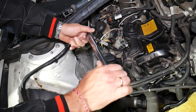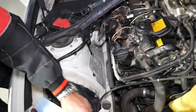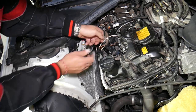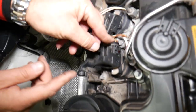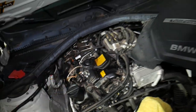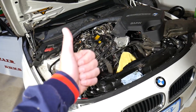That's it — one well-torqued spark plug installed. Now install the ignition coil, push it all the way in, and when you reconnect the cable cap, push with your finger while closing it. Put the top together and you're ready to go. Hopefully this video is helpful — thank you for watching, and see you guys next time.